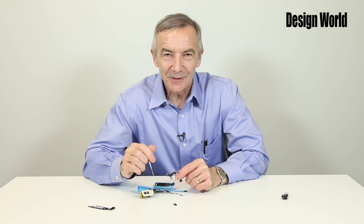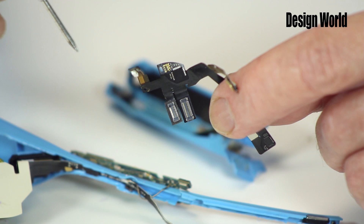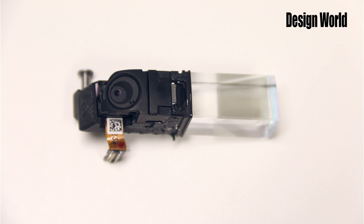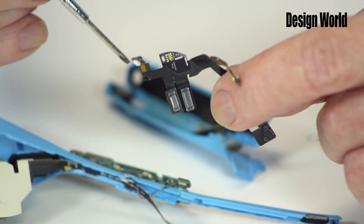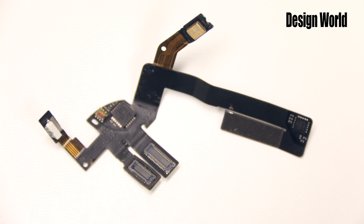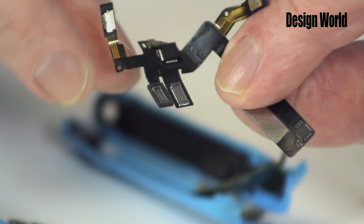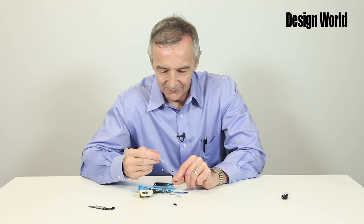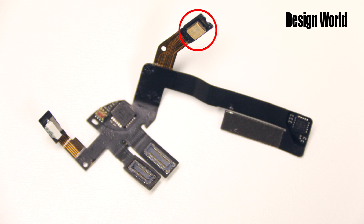A complicated flex circuit connects the main logic board to an assembly mounted on the other side of the pivot hinge that lets the user move the display into a comfortable position. The assembly on the other side of the hinge contains the display and prism, a camera, a microphone, and an ambient light sensor. The microphone is another MEMS digital device, and the digital nature of it comes from an incorporated analog-to-digital converter, so the output of the microphone is a serial digital bitstream, not an analog audio signal. It's kind of hard to tell this is a microphone just looking at the package — it just looks like a metal can.